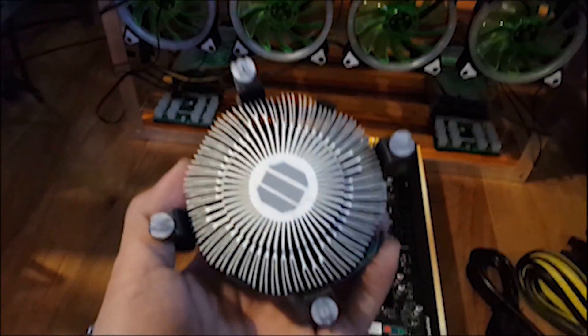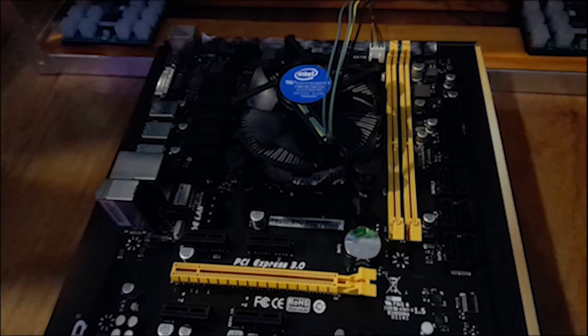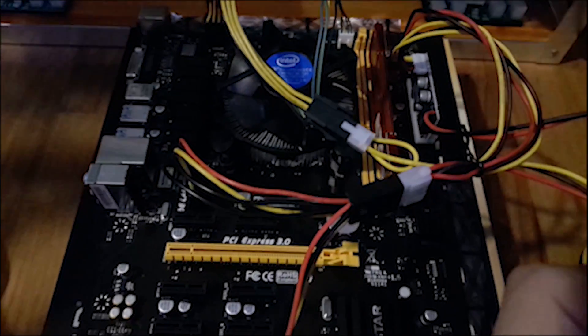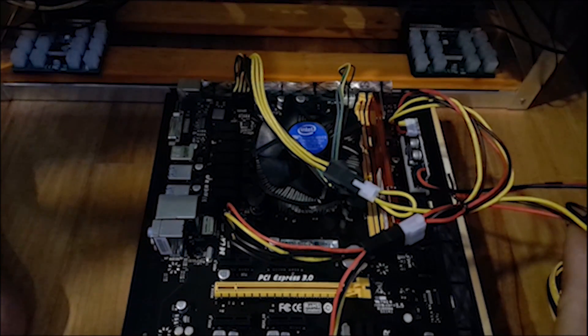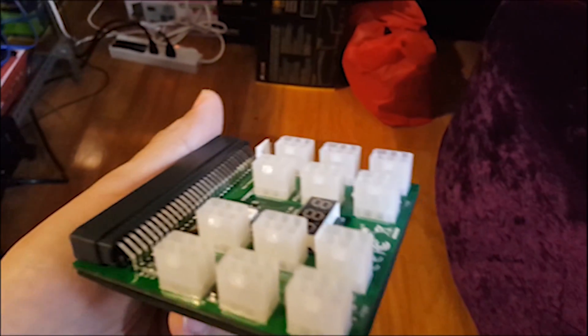Putting together the parts: install your CPU to the motherboard. It's pretty standard for new CPUs to have a CPU fan that comes with thermal paste already — just place it on the CPU and lock it. Make sure to connect the CPU fan cable. Install the 8GB RAM. For this rig, I was actually planning on using 2 server-type PSUs and powering the motherboard using a Pico. Here's the 24-pin to be connected to the motherboard. I have a 4-pin to 8-pin extender for the CPU power, a Molex splitter to power up the additional Molex connections of the motherboard, and then the SATA connection for the SSD. The other 6-pin PCIe will be connected to the breakout board of the server-type PSU to power up the whole thing.